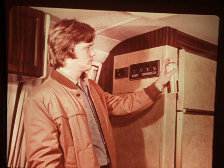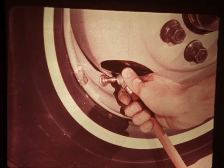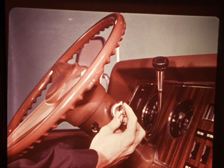In moderate cold storage, open the motorhome about once a week and check it for mold, water seepage, and odors. It is okay to use household air deodorizers or disinfectants in the motorhome, but they should not be sprayed directly on any surface. Check the tire pressure during these weekly inspections and be sure to maintain it at 60 PSI to prevent tire damage. If the batteries have not been removed, it's recommended that the engine be started once a week and run for about 20 minutes to be sure it will start when the storage period is over.